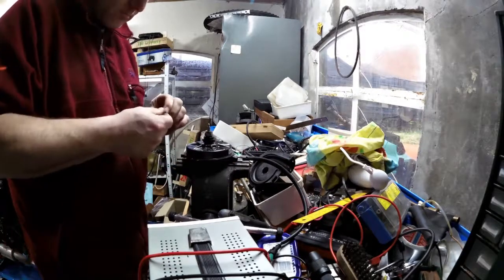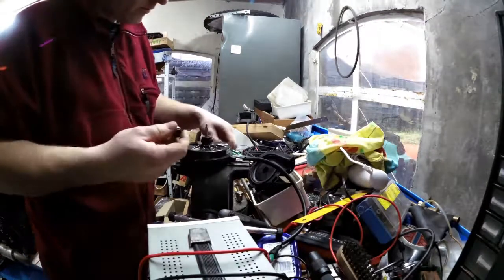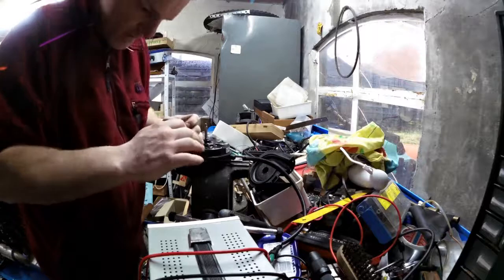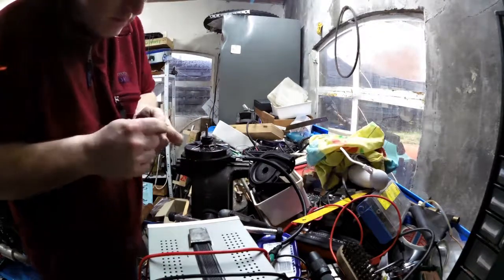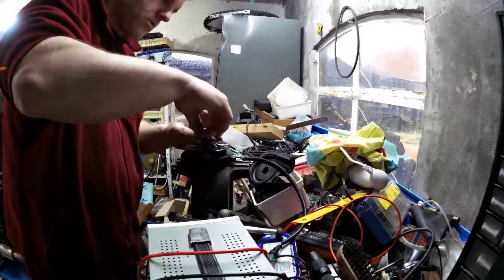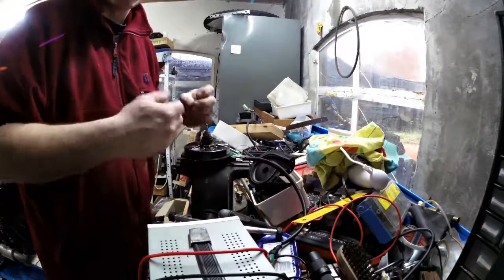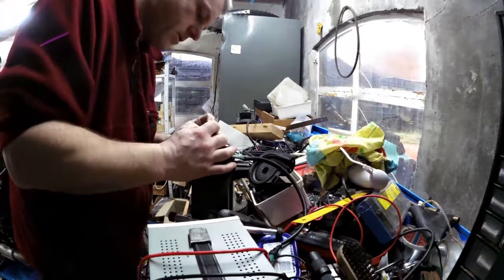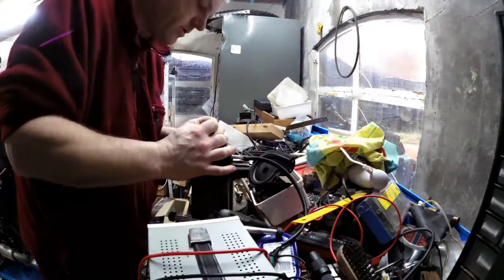Okay. And this actually gets into touch with water, or coolant, as we say. So if you have any leakage here, it'll blow out there. Will not enter the engine. So, okay, that's okay. Now I don't see any gunk on the rubber gasket here. But this could also mean that the reason why it draws the amps is because this is dry and it needs to be wet to run without a hitch. Pretty sure that's it actually. Because once I remove that, the engine goes down in amps very nicely.